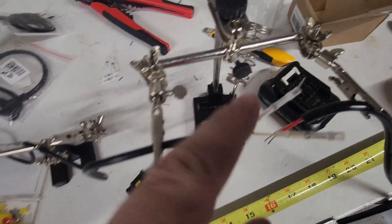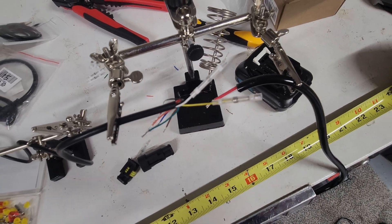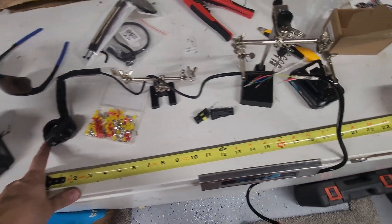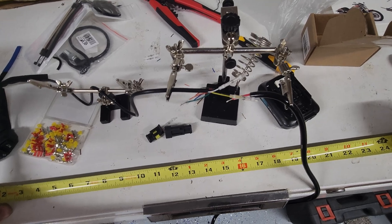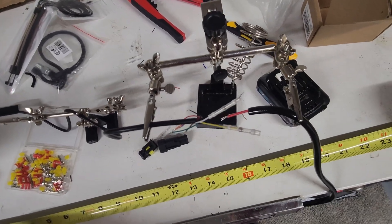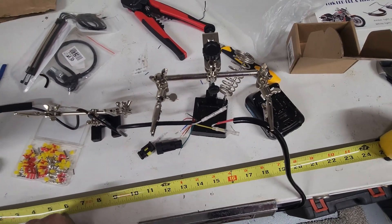This white and yellow is to trigger the relay, and I just have this hooked to the two wires coming from the relay. There will be a third wire — on this harness it was black — but I just clipped it because you don't actually need that. If you do wire it up, sometimes it will make the switch light up all the time when connected to power, so make sure you wire it correctly. I like to use these little tiny solder seal connectors — they work really well — and then heat shrink on top of that. The blinkers go to the green and the blue, and the brown and the orange are for the horn, and red and black is just positive and ground.